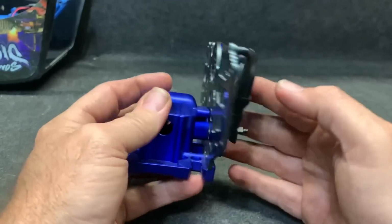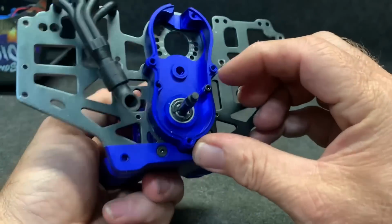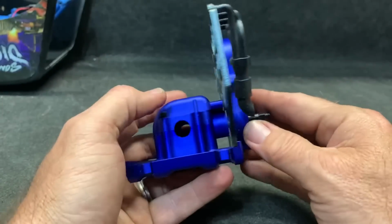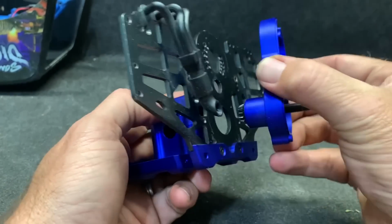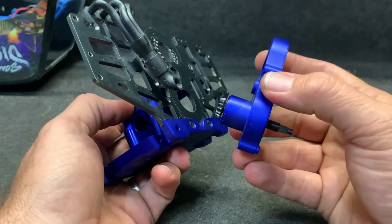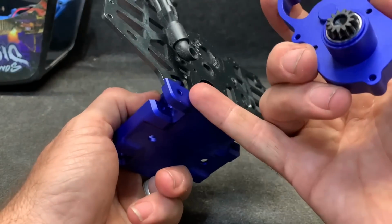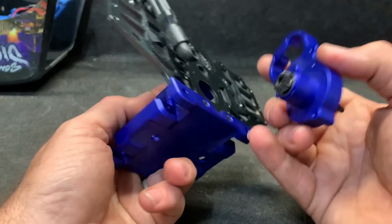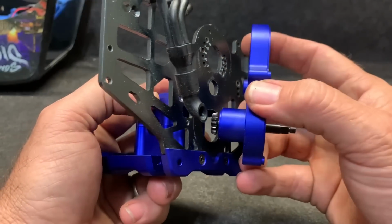Okay, so you got one bolt at the top to take out. That's it. And then these two bolts right here and here go into the top case. And you can take out the whole pinion and everything. Then, if you want to get to that, you can just simply drop those out and then the whole belly comes out. This is nice.